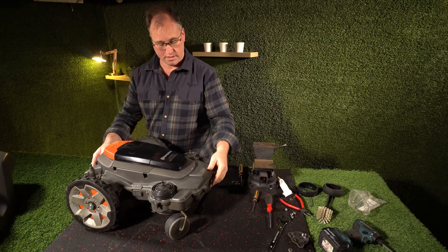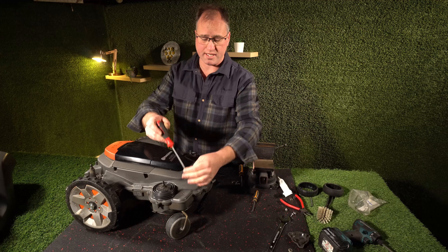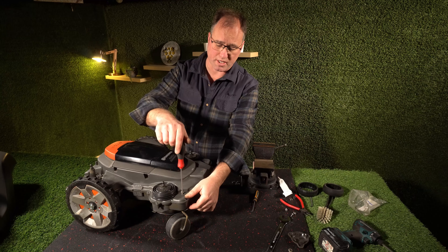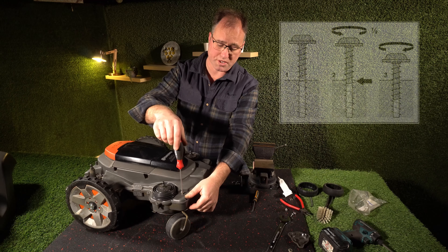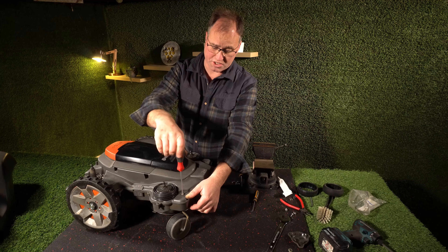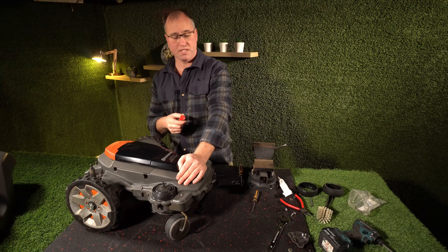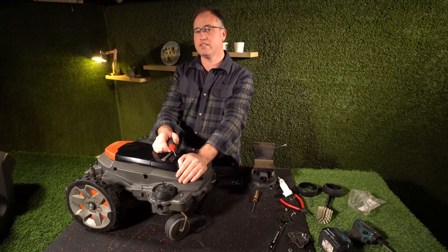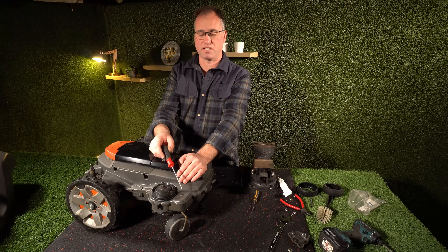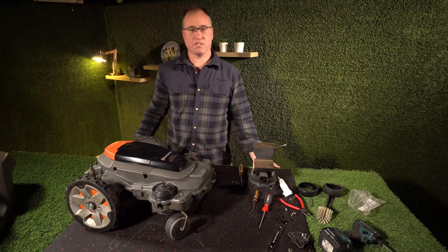So put the main board back in with the ribbon cable and gently fold that forward. When doing your screws back up, do an anti-clockwise turn first to locate your thread. You'll hear or feel it drop into the thread and then you know it's located. If you don't do that you're just barring straight through the thread, creating new thread each time — eventually you're going to strip it out. You might get away with it a couple of times, but when you're looking at a unit you want to have for 10 years and you're into it every year, you're going to do some damage eventually and end up stripping out half your screws and having to put thread inserts in them. And that's not fun.